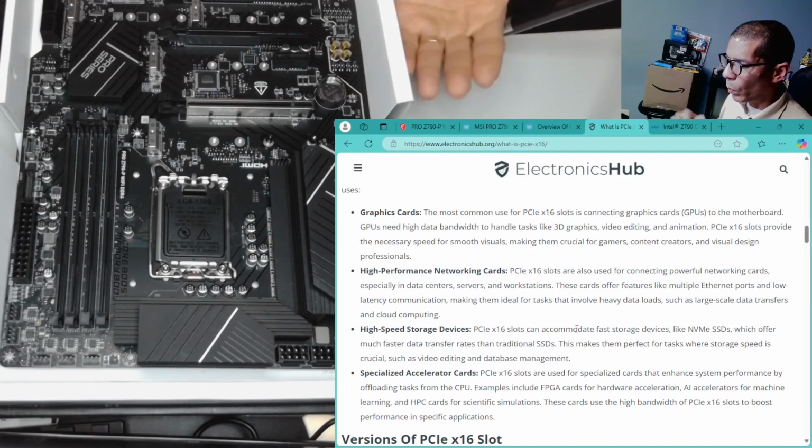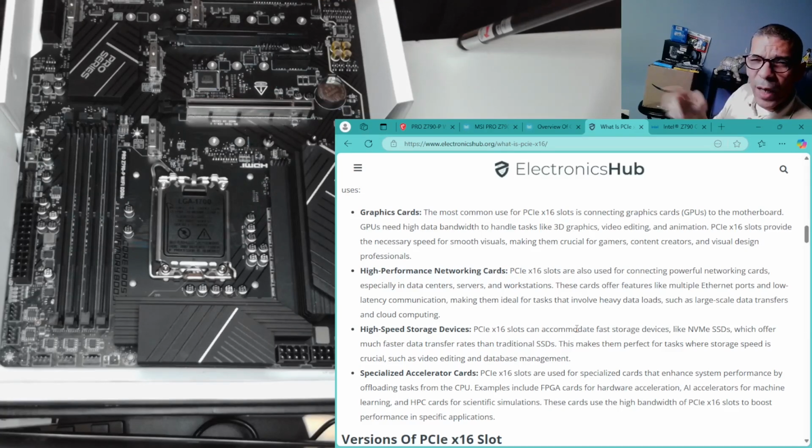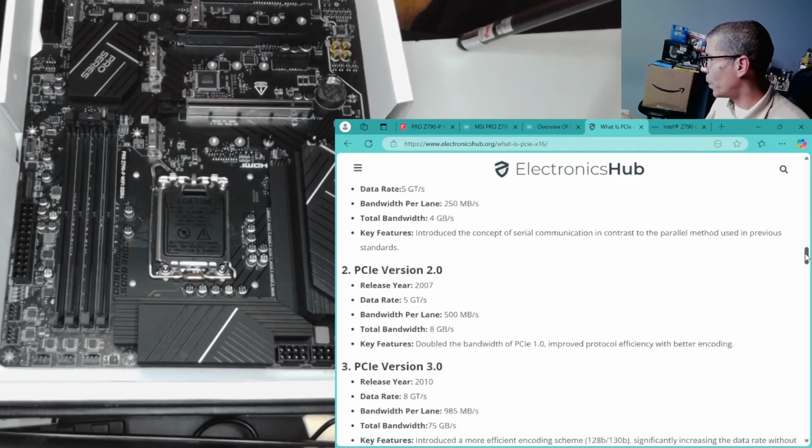in the event that you need to upgrade your existing motherboard and you want to add SSD to it, well, you need to find a PCIe slot that is available in your motherboard with the highest speed. And if there is something there already, find out if that card actually takes advantage of the speed that it is plugged into. So by just doing a simple swap, you'll take advantage of the card that you just purchased to enhance your machine. So let's see what else we have here.